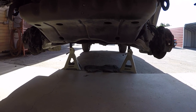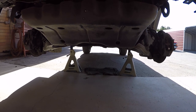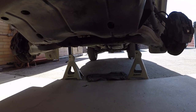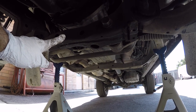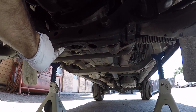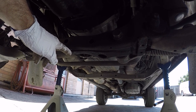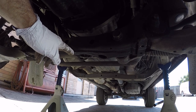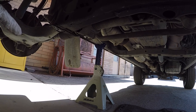A place where I like to lift up the front end on a first-gen Tacoma or third-gen 4Runner is the cross member right underneath the front of the rig. It's basically the cross member that the steering rack connects to, so if you're able to get the jack right in the center of this cross member, you can jack up the whole front end equally at the same time and then get your jack stands in place on both frame rails.